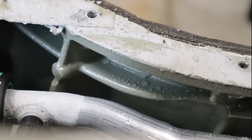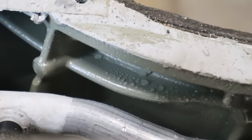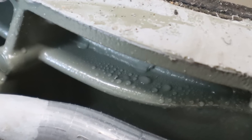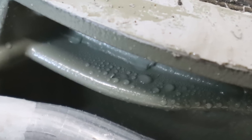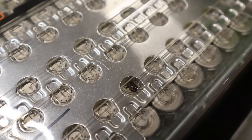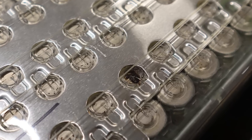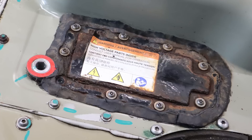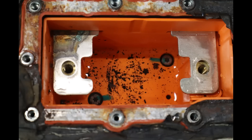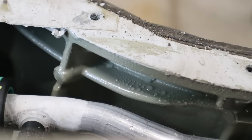Right here is the outside of the case at the area we were just looking at, and you can see some pretty big water droplets. But there's really no way for water to get in — this whole area was very well sealed, and it's at the far opposite side of the battery pack from the main fuse cover. Based on that, and the surface corrosion in a few other places where water couldn't directly have gotten to, I'm pretty sure water got in through the rusty high voltage fuse cover, and inside that box there are a couple of little holes higher up.